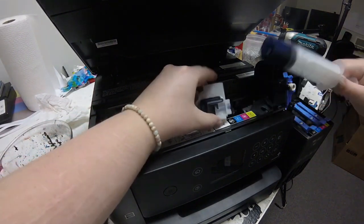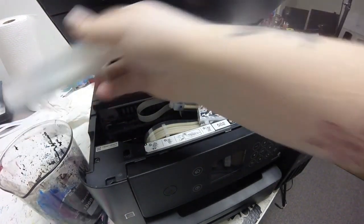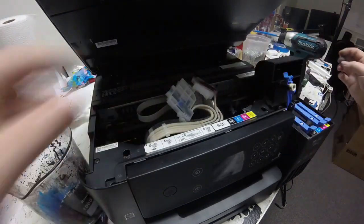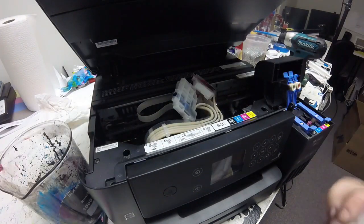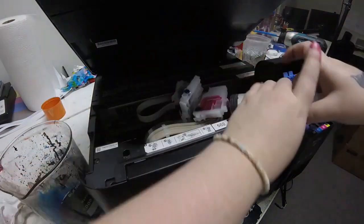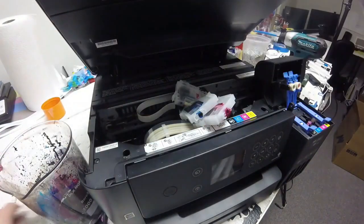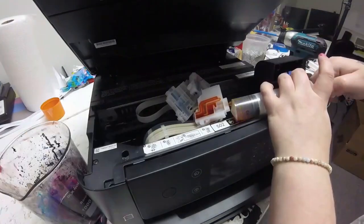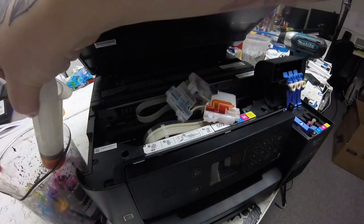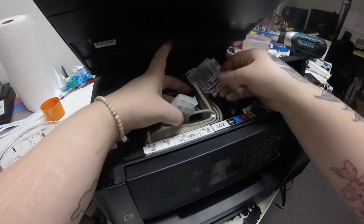Here I am pulling the blue ink all the way through the tubes up through the ink cartridges. This way I can get ink from the ink tank to the cartridges. The magenta is also pretty low, so again I have to open up the tab on the right-hand side and I'm just pulling some magenta through — those look good. Same with the yellow, I just need to pull some yellow through, opening up that yellow tab on the far right side. Now I'm plugging all of my cartridges back in.